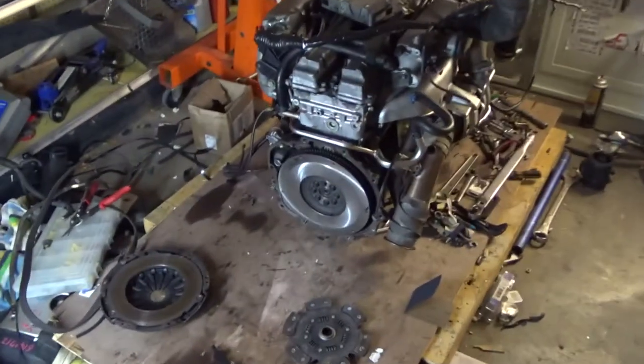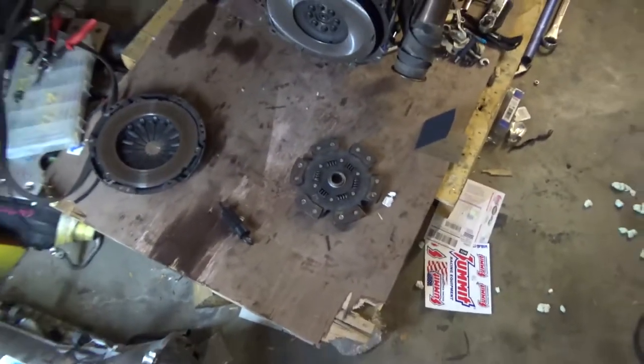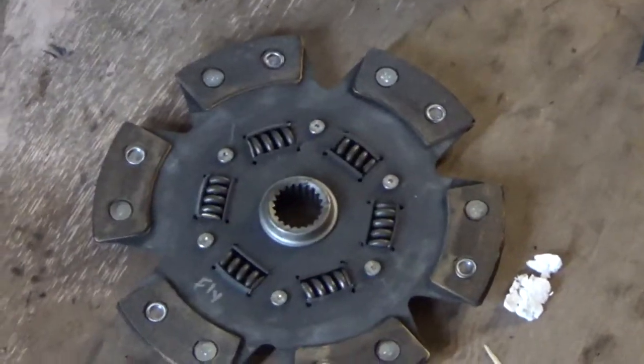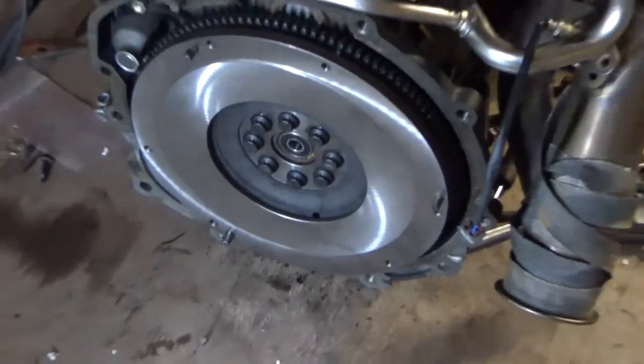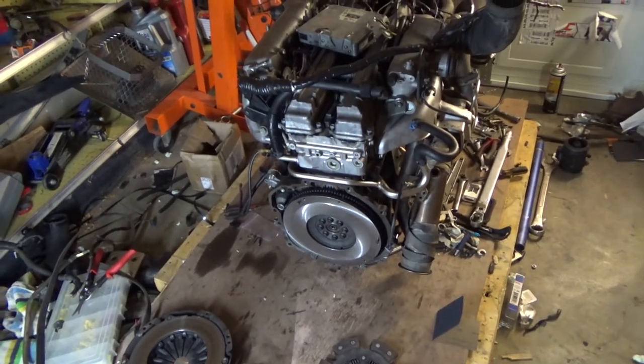David came over and we've got a snowstorm out here in Colorado, so I've got my ghetto light setup and this little shitty heater. I got the clutch tool at O'Reilly for JZ parts — imagine that, I thought everyone said you can't get JZ parts. So I bought some sandpaper, I'm going to scuff up these pucks on this clutch, and then put it on the freshly machined flywheel. Put the ARP flywheel bolts on everything and lock-tite them.